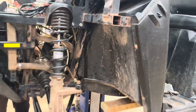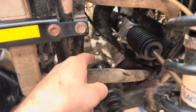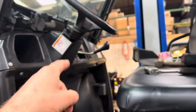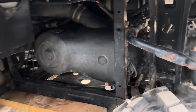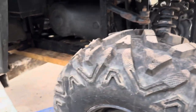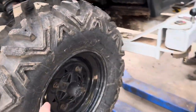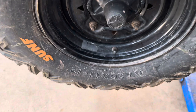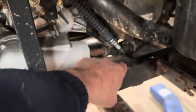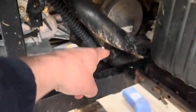So yeah, she's going to be rocking and rolling by the end of the day. She's had new pads, new front gear case output hubs, new front drive shafts, new rod ends, new steering rack, new steering support bushes. There was loads of play in those. It's going to have block off panels, which will stop the crap from going forward now. Crap is the old English word for, you know. New tyres all round. We've put the 26-inch tyres on it. 26s, yeah. 26, 11, 12-inch. I think it's had a new transmission in the back as well, and new UJs on the prop shaft as well.